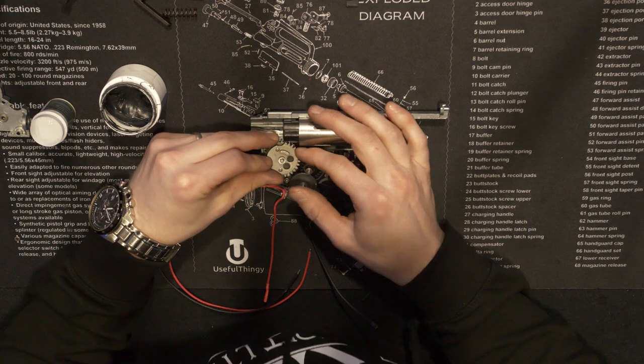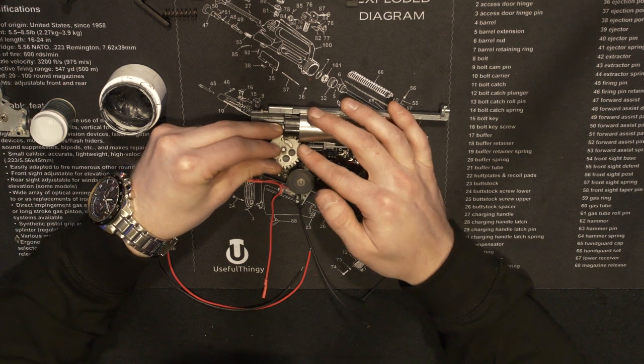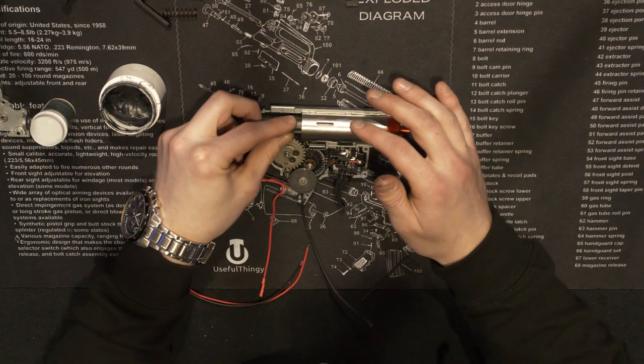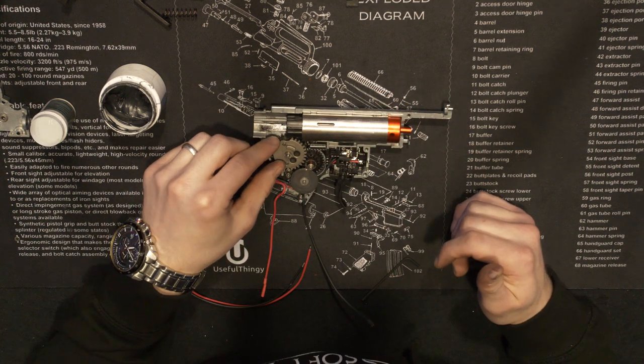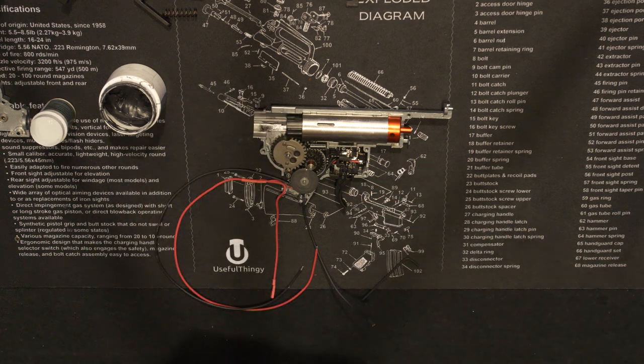It's a bit of a fiddle to get this gear into place, and you want to make sure that the shims have not come loose. A little bit of grease always helps to keep them in place. The raised section of the gear, so the delayer, needs to point upwards towards you, because the tappet plate will work off of that part of the gear.